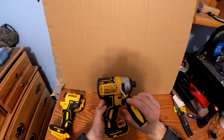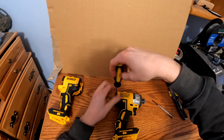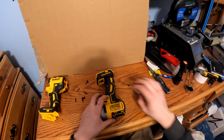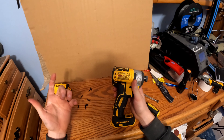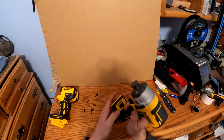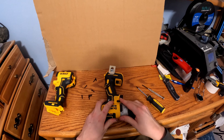You're going to take out one, two, three, four, five, six, seven, eight screws and then pull it apart. Once all your screws are out they should come apart, but be careful — there's a spring in this part right here that keeps the gear selector in positions one, two, and three. Just be careful when pulling apart so that spring stays in there.